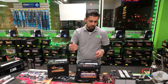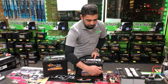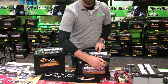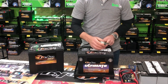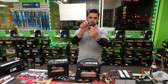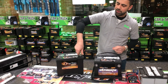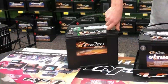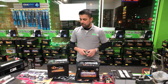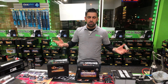For a side post battery, you put the brush inside the battery terminal and spin it, then do the same to the side and brush the front surface. For the top post battery, you lock it from the other end — there's a hole — you put that on the top post and spin it for maybe 20 seconds. After you clean it, everything should be good. That was tip number three.